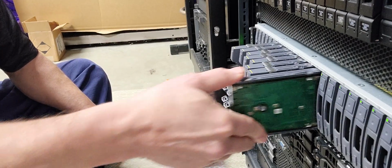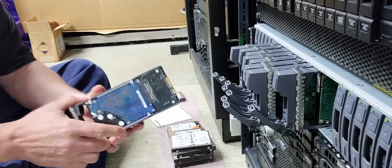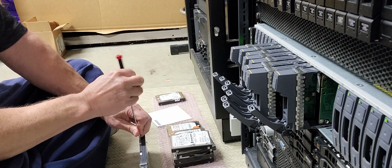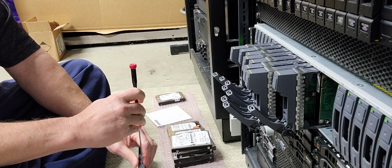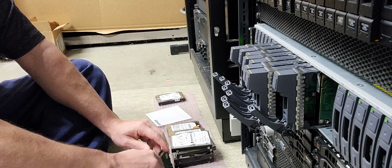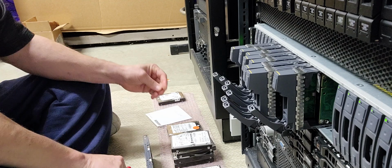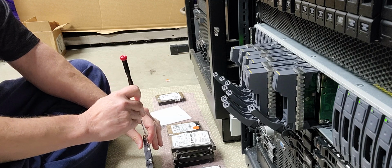You can get the quality of RAID controllers, and you can get the quantity of the HBA controllers, turning what I call just a bunch of disks into a pretty interesting combination of protocols. And yes, you've broken the mold. That's not what they recommend you to do, and you're cheating, and you're getting away with basically storage murder by taking RAID controllers, setting all your disks as RAID 0 individual disk sessions, and then turning around and HBAing them through the software tool. And now you can use your RAID controller software diagnostics to talk RAID language at the hardware level, while you're doing performance metrics on your TrueNAS platform, and one may never see the other.